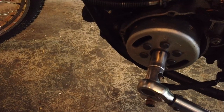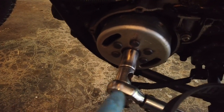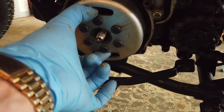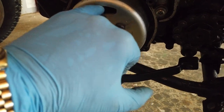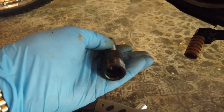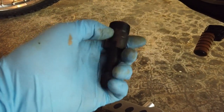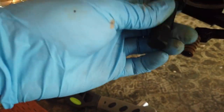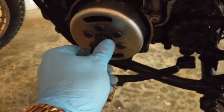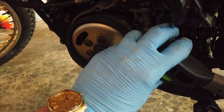The reason it came off before is when I tried to start the bike it unfurled easily enough. I do have an electric impact drill but I think I'll be able to take it off with this. There are horror stories on the internet of people putting pullers on either side and trying to pull it off — it causes too much stress, you'll either damage the magneto or break the Woodruff key on the shaft. You want to buy a hub puller — only costs about 12 to 15 bucks. For this particular magneto on the 175, it's metric, M27 by 1, and it's a left-hand thread.